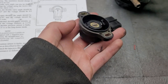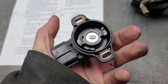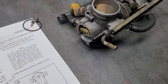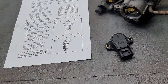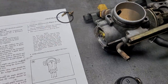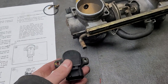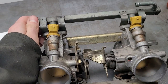This thing doesn't look bad — nothing's corroded, nothing's broken. But you can't adjust these effectively without the Arctic Cat TPS adjustment tool. You plug it in, hook up your ohm meter to the tool, and just twist it — reads really easy. I didn't trust myself to put a new one in, and you can't get a new TPS from Arctic Cat — they don't sell them separately, you have to buy the whole assembly. So I bought a used throttle body off eBay and I'm hoping that'll work.